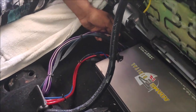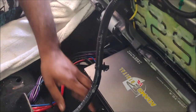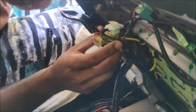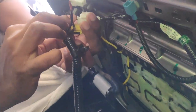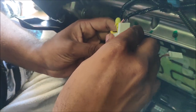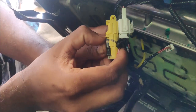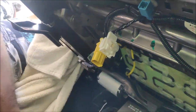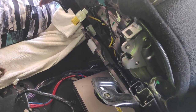There are two connectors below the seat — one is the airbag and one is for the motor and accessories underneath. Before you remove the seat, I would suggest wrapping the side skirt with a towel or anything just to prevent scratches when removing. The last thing we want is scratches on our door. Work safely and be smart. This connector was a bit unusual — the clip is broken, and the owner mentioned the previous installer may have broken it. That's how you remove the clip.